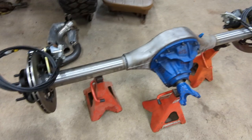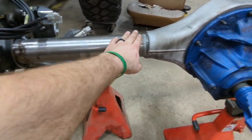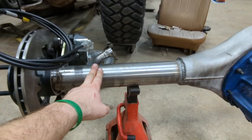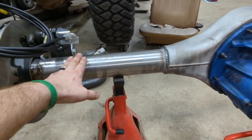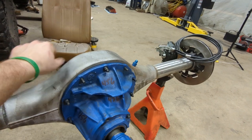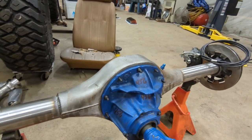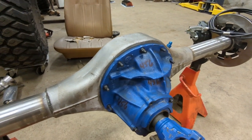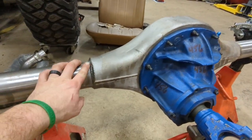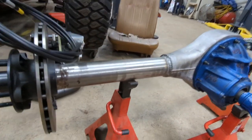The plan is to do link mounts coming straight off from the front leaf spring hangers, because they're a tab that's already welded to the frame, easy to access, and it's a pretty standard width — so we can get a bushing for that and build our lower control arms out from there. Then we may just do a three-link with one upper off the top of the case with a bracket, and either add a cross-member in the frame or use the cross-member up near the gas tank. Then we can do a panhard bar across — or even a watts-link would be better, but we're probably not going to get that crazy with it. That's how you build a Speedway Motors Grand National Ford 9-inch.